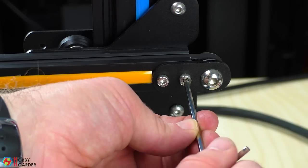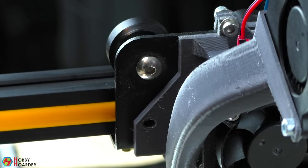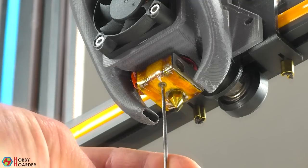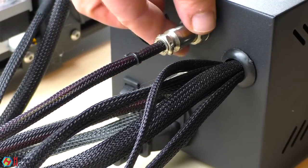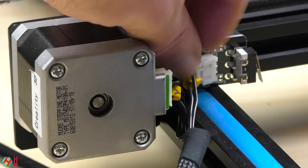Finally, check and tighten all the screws, but don't use too much force. The screw that holds the heater cartridge in place is especially critical. If it's loose, the heater might shake loose and fall out, which is a major fire risk. Before you turn it on, quickly check all the cables again and that they are plugged in correctly.